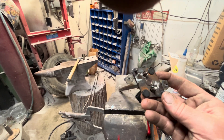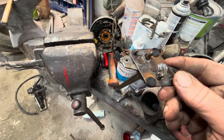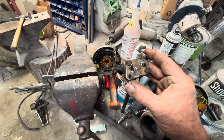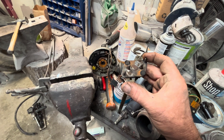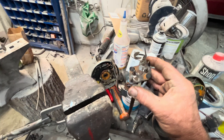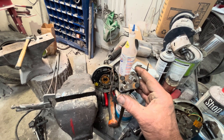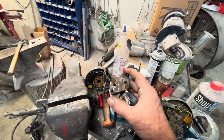So what I do is I take these holes here and weld them up. You see this one? So now we've limited the advance a whole bunch. We've taken more than half of that out of there, so we're going to end up with 10 to 15 degrees of centrifugal advance. I'll be able to run this thing at 25 to 28 degrees at low speed.